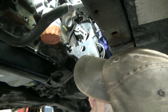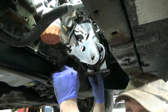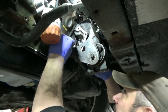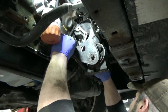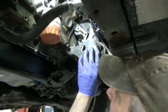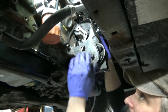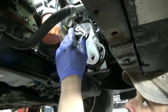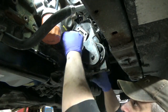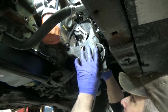The wiring harness is running outside of that so we don't have anything to worry about there. On the back side of the block you've got to hook up the knock sensor — that was like the only wire we had to get from down here, so that was pretty cool. The wiring harness did a good job on this — you didn't have to really remove much to get it off. We had to take the alternator off just to get the harness all the way down through here, which was some pretty good thought process they put into that.